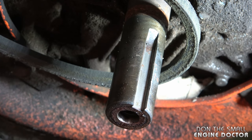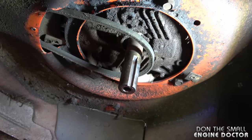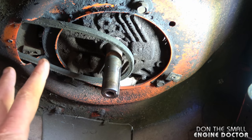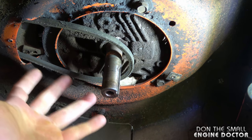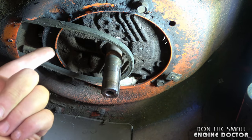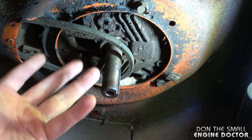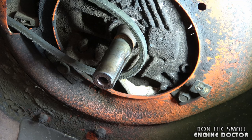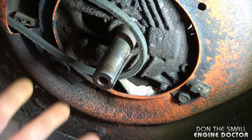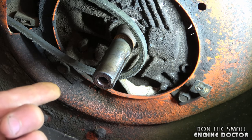If your crankshaft is bent like that, you're going to have excessive vibrations in your lawnmower. Sometimes you can try to straighten it by giving it a dead blow or hitting it with a proper hammer. There is a tool to re-straighten a crankshaft, however it doesn't always work. Sometimes the best bet for customers is just to buy another mower. So if you've hit something hard with your mower and it hasn't been quite the same since, you more than likely have a bent crankshaft.